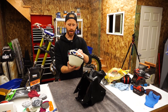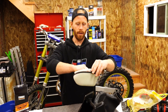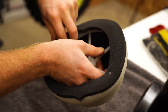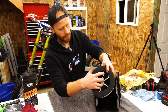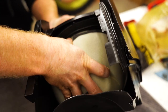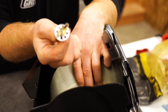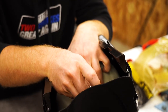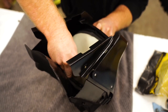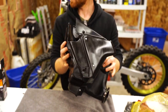Now we're going to throw in a Prox filter. Got our filter cage here — I'm actually just going to be putting it in dry for now. I don't know when this bike is going to be up and going, and I'd rather not have the filter just sit there dripping with oil till spring. That fits nice. We want to make sure that the pin right here goes through this hole. You want to line up that mark with this little point here. We've got our bolt — even got a sweet little drilled washer on that one. I always like to give the filter a little wiggle to make sure that cage is set in place.